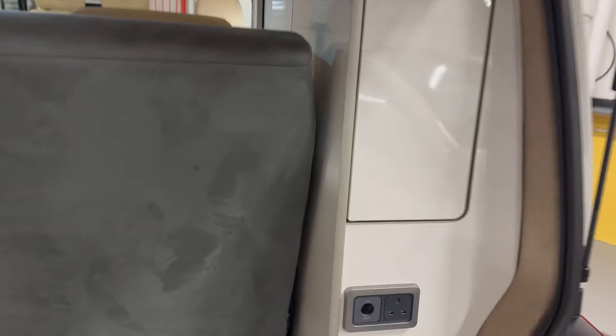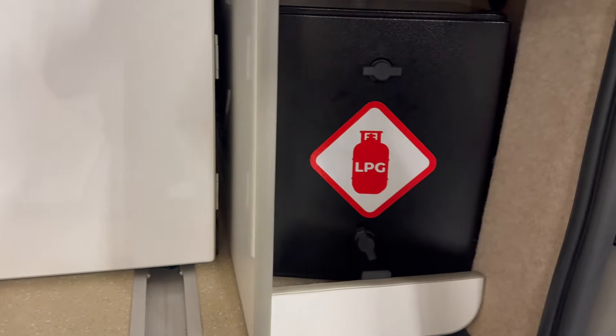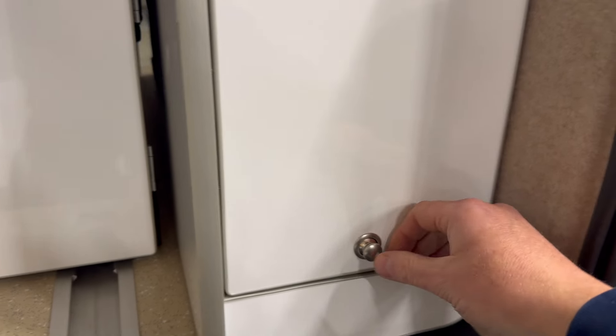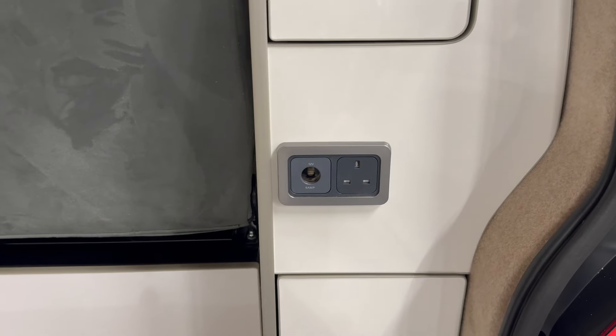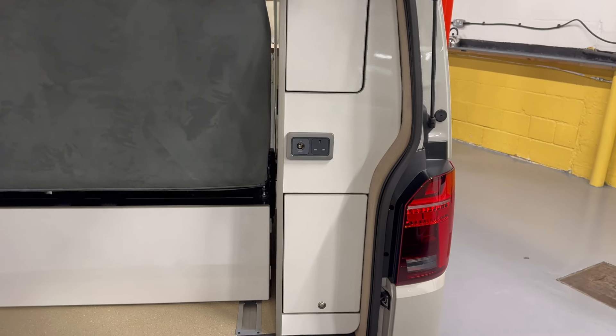At the back you've got a nice cupboard space in the top cupboard — we've got the tow bar bag in there at the moment — and at the bottom we've now moved the gas from the main living area cupboards into this rear cupboard, so all of our conversions will now have the gas in the rear cupboard. We've redesigned this door with a little handle latch to fit properly for the gas canister. This customer also wanted a 12-volt and an extra 240-volt socket fitted in the back, and we can add extra sockets inside the van at different places as well.